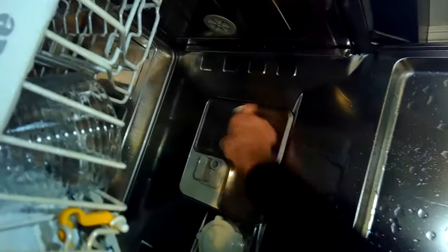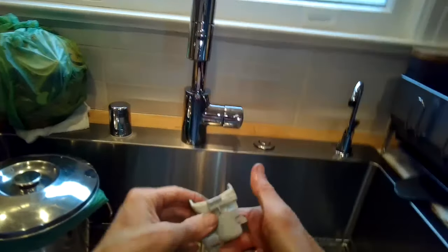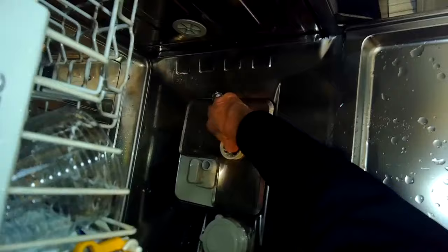We'll lift up on the lower spray arm, turn the triple filter arm, and pull the triple filter off. We'll pull this little one-way valve to our right-hand side to release it and pull it out. There should be a steel ball bearing in there that can move around — we shake it and see there's nothing caught in there, so that's not the culprit. You might also check the little impeller underneath to make sure it can spin easily, but this all seemed really good.